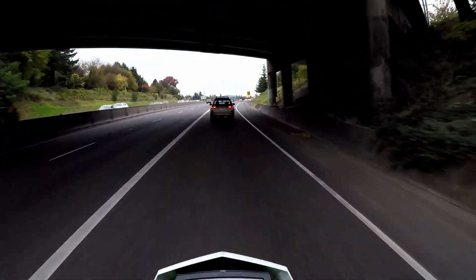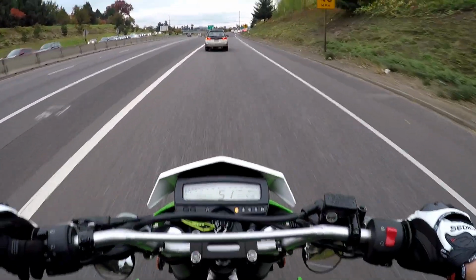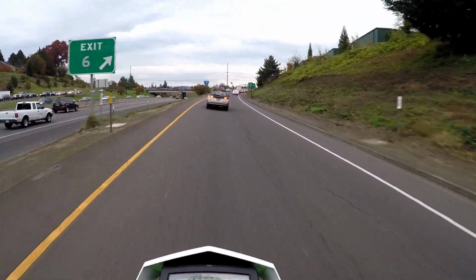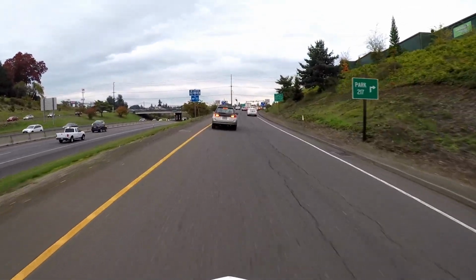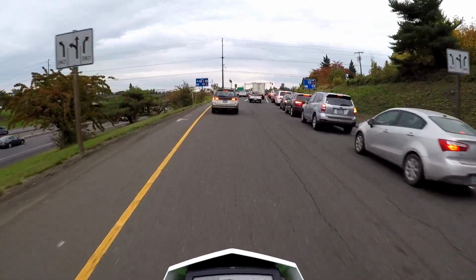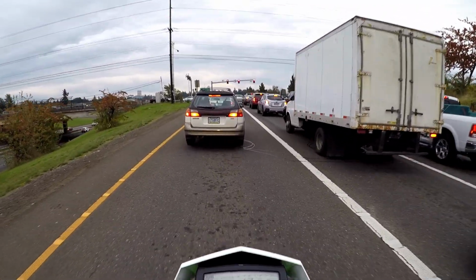Of course, if you're going to be putting some hard highway miles on this, you're going to want some more power, or you're just going to want to get a different bike. Or I suppose you could gear it higher and the RPMs would be a lot lower, but you wouldn't have much passing power. For my purposes, 13 tooth does great.